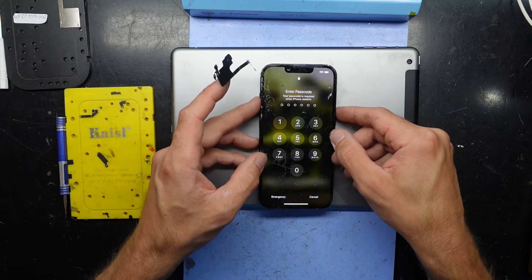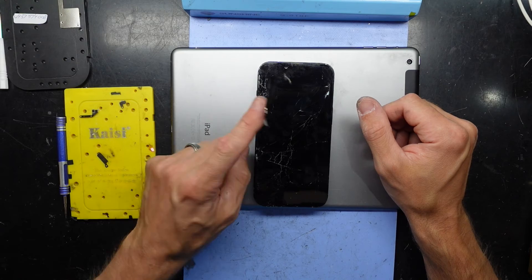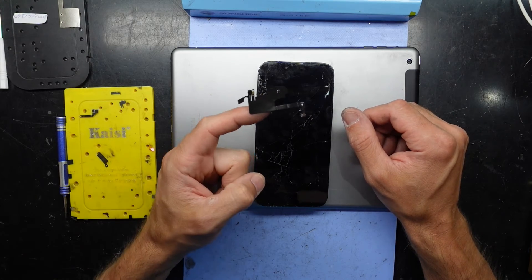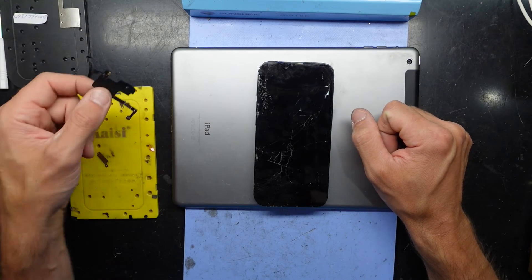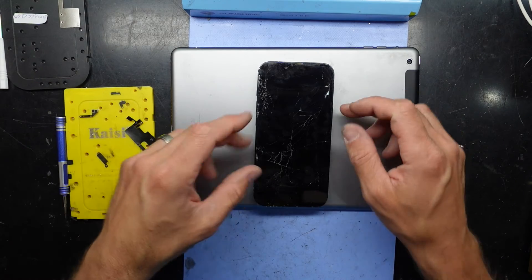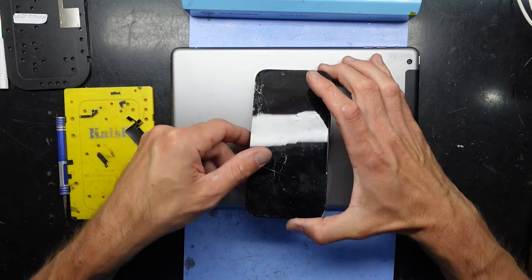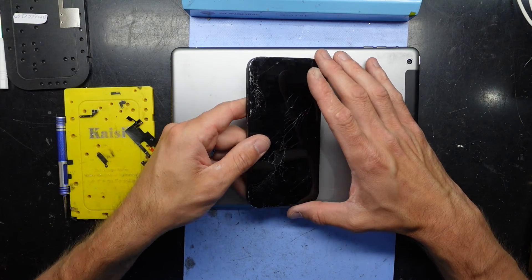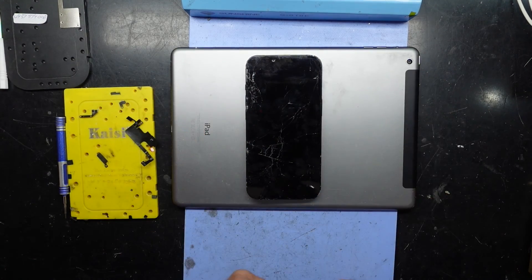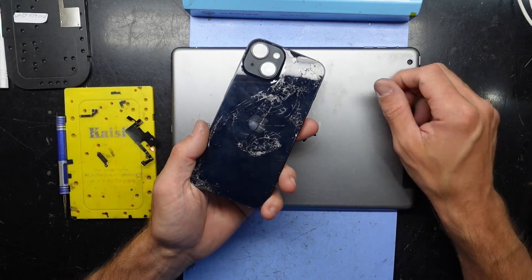So hopefully, if your phone is stuck in a rebooting Apple logo and your phone is liquid damaged, disconnecting this sensor flex will at least get your phone on so you can get to the data. There will be a fairly high risk for unskilled people opening the screen — it can damage the display, so the risk is very high. But if your data is that important, it may be worthwhile attempting it or taking it to a local repairer to do on your behalf. Anyway, that'll do — see you guys later, bye.